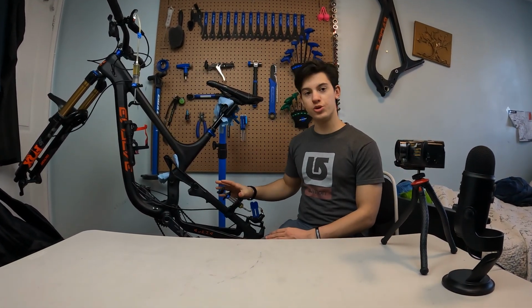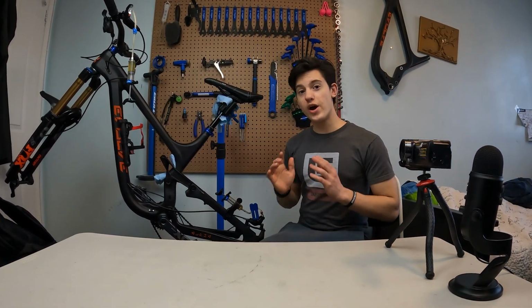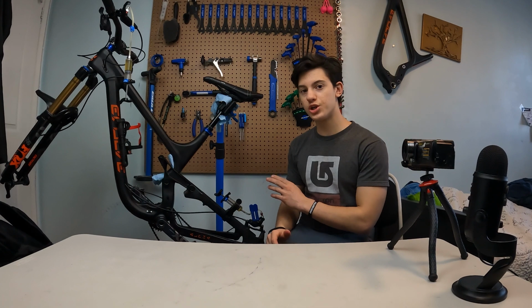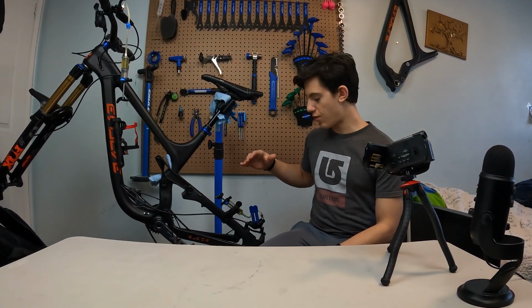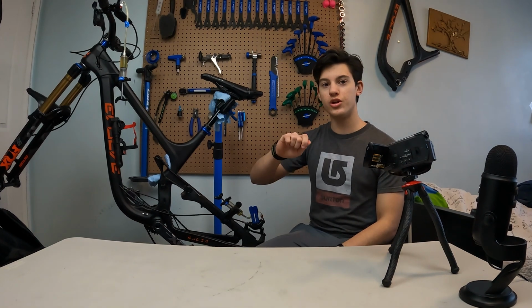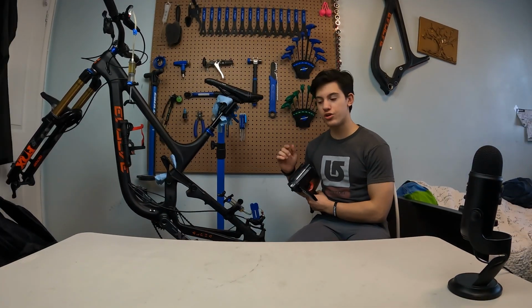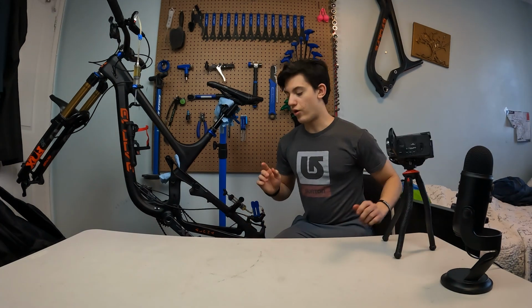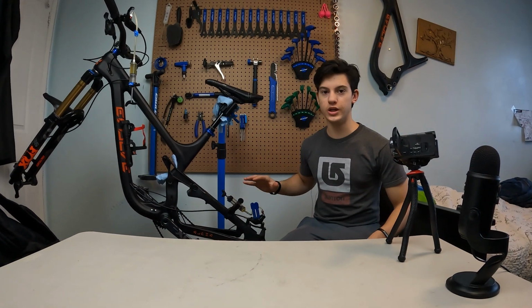So now we're gonna push most of the liquid from the bottom all the way to the upper one, and right after that we gotta close that syringe hose by using this little clamp. So now the hose is closed. Now we gotta close the system by turning clockwise that little silver adapter for SRAM brake, and we gotta turn it clockwise until it stops. Alright, so now it has stopped, but don't remove it, not yet. We still need it right here.